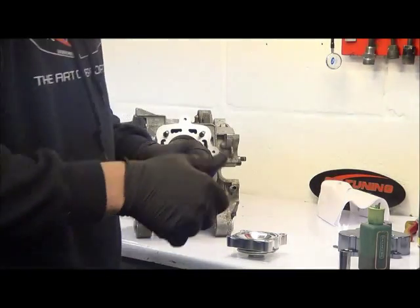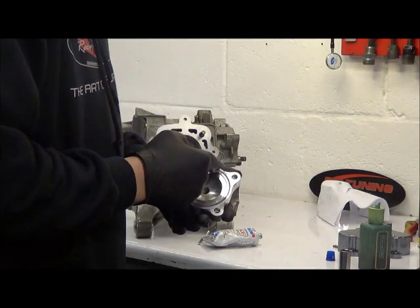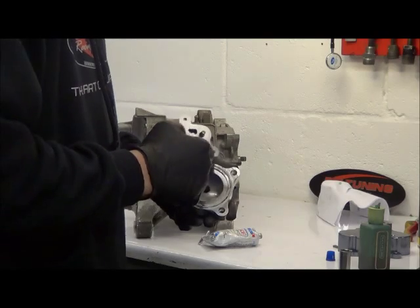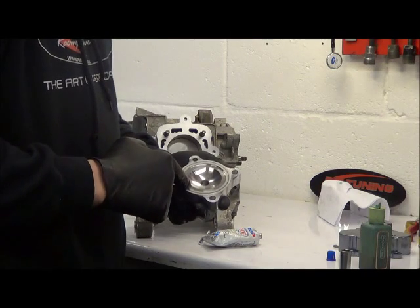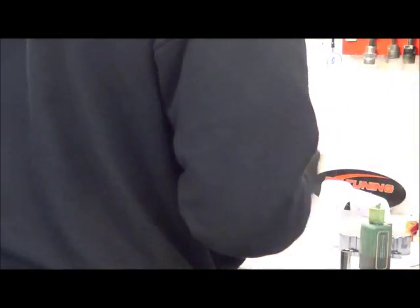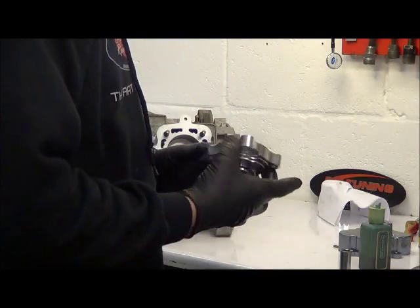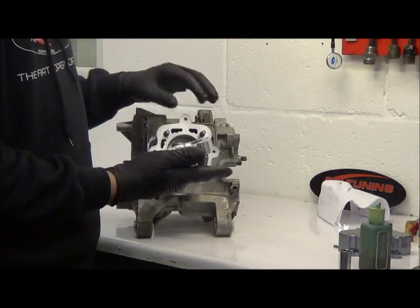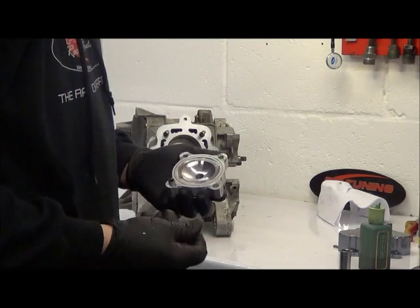Apply a small amount of rotor seal — again we're just rubberising the face here, so we don't want to put too much on. Make sure you've got a nice even coat. Now before we proceed we need to fit the locator dowels. The locator dowels serve the purpose of centralising the cylinder head combustion chamber central to the bore, so you don't get any overlap of the mating face to the bore itself. Pop those into place, give them a wiggle and they should just drop in.